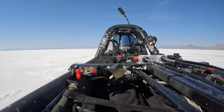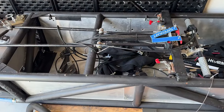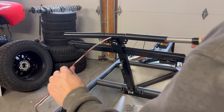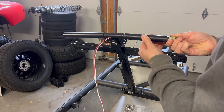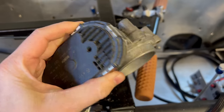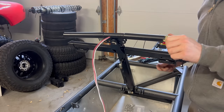The controls on this car are all motorcycle-style. The throttle is a twist on the right hand, and I had two cables running back — one push and one pull — so if the throttle gets stuck I can hopefully roll it back. This kind of sucked: the cables were long, the routing had several curves, and the actual throttle feel was really bad. I had to use pretty strong springs just to make sure the throttle would stay closed. So I decided to switch to a throttle-by-wire system. Pretty much every car made in the last decade and most motorcycles use a system like this. It's strictly a packaging thing for me, and it helps a lot.